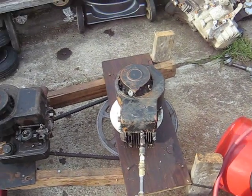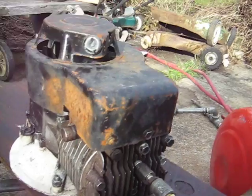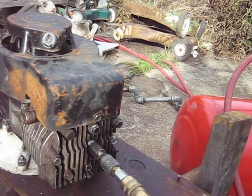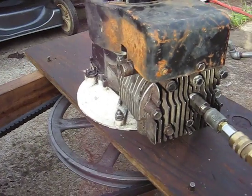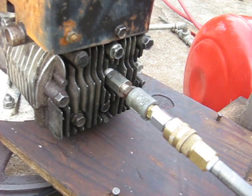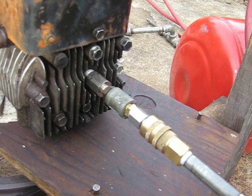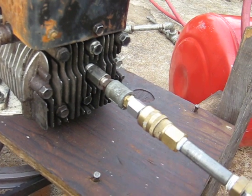We're at stage eight. I went back to my old engine, the one I used on stages one through three, since I wasn't really convinced it had that bad of a cylinder in it. I've done something pretty radical here. What we have is part of a compression tester that screws into the spark plug hole. I modified the cylinder head for pretty high compression, and then we come out with a fitting here just into an airline.